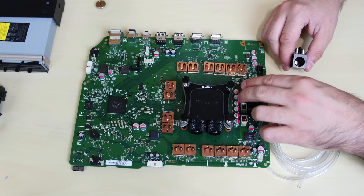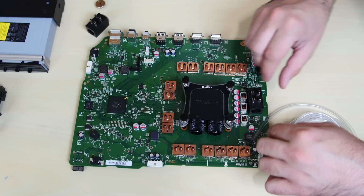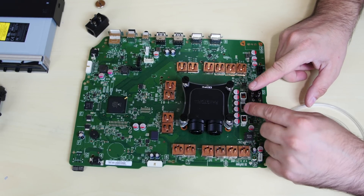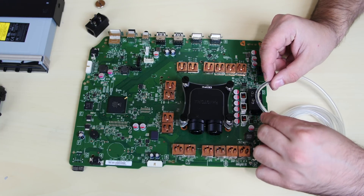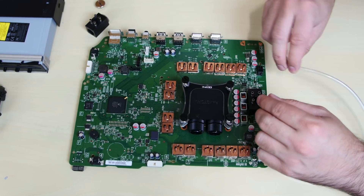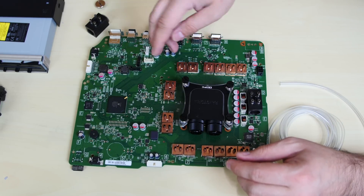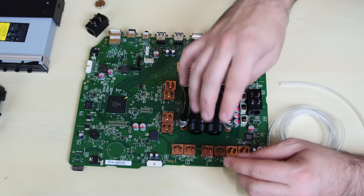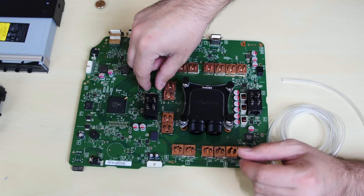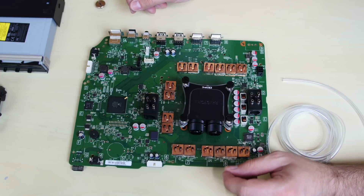The way it's going to work: I'm going to have the outlet of this CPU block going into the first splitter, right over here. The fitting and tubing connected to this one will convert the fitting into the smaller 3mm tubing. I'm going to split it off in fours — four tubes going to four blocks. The outlet of each block jumps into the next four, and those outlets jump into the next four, until we get to the next fitting up here, which turns to that big tubing going outside to the reservoir.